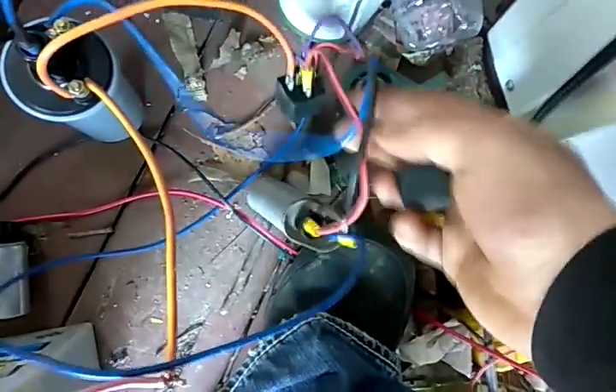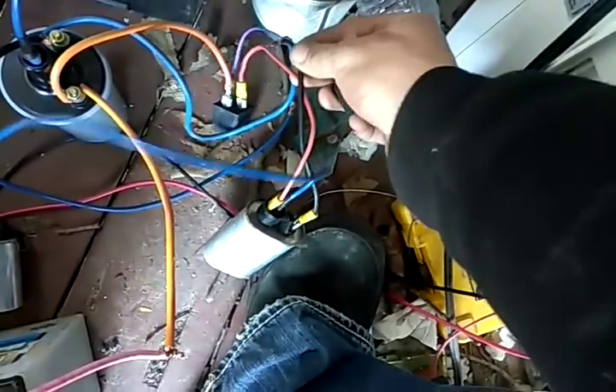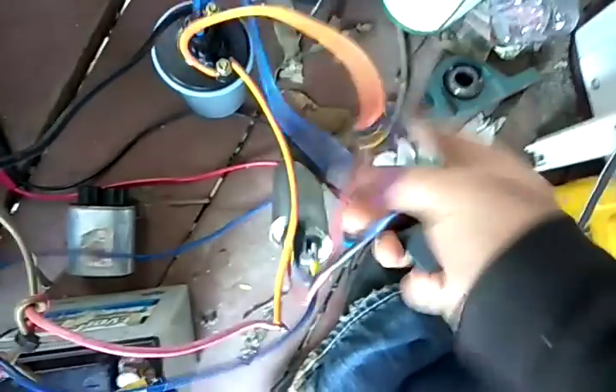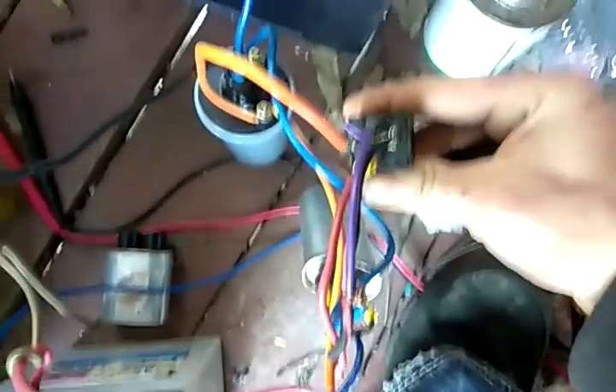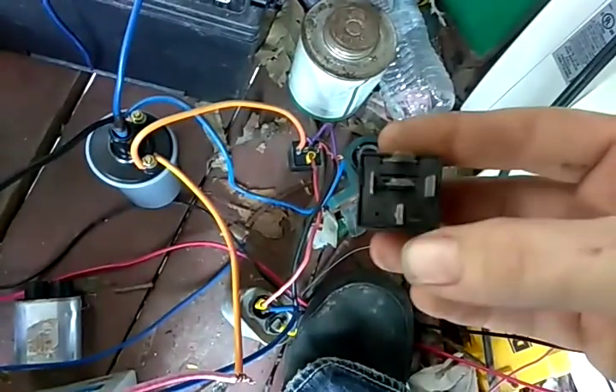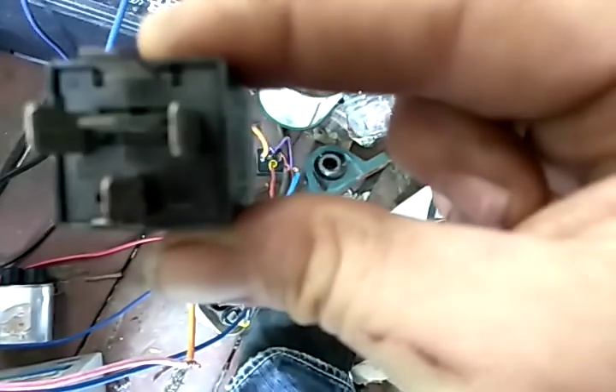There are actually four wires tied together right here. This black wire goes not only to the negative on the ignition coil with that blue wire all tied together, but it goes to number 87A and number 86. You guys may want to pause it right here and get a good shot while it's wired. This red wire is number 30, which is this one right here.